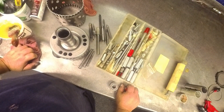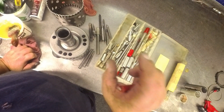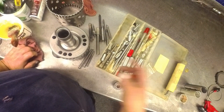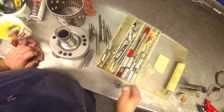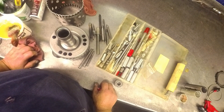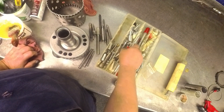Some case bushings have oiling holes you've got to line up. Some case bushings have a bracket, and you might have two bushings with one on each side of the feed hole. You've just got to look and see what you've got before you start taking it out. The second step is taking it out, and then the third step is putting it in. Some have to be at different depths.